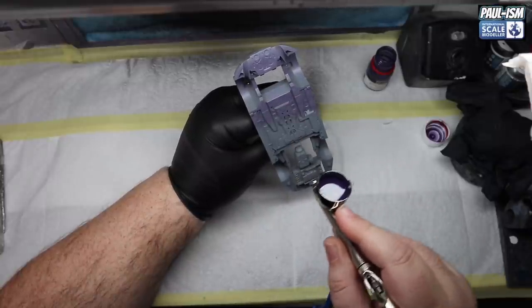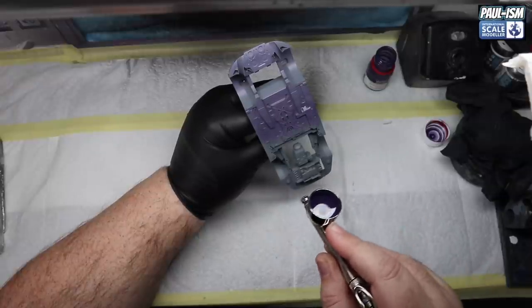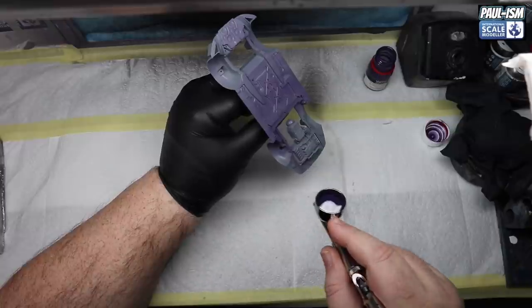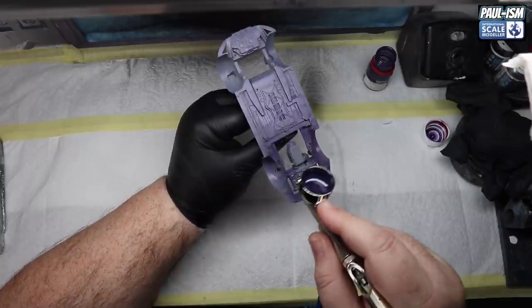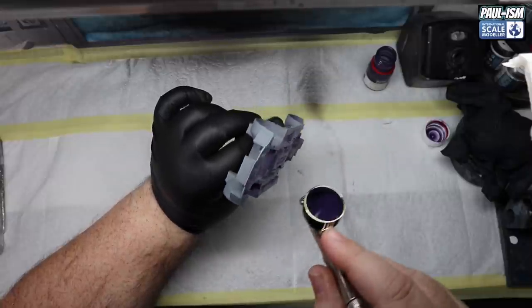But a thought on this one, we'll do it the body colour. So nice light coats building it up. We're at 18 psi, we've got the 0.35 Apex. I have separate airbrushes for all the different types of paints, from lacquer, primer, metallics, UMP primer, 2K, and we've got a detail one for our lacquer as well.